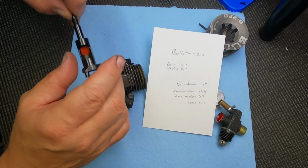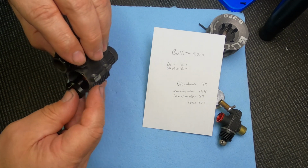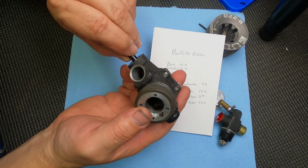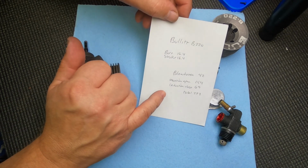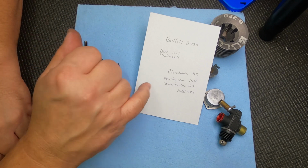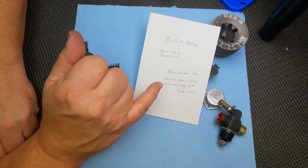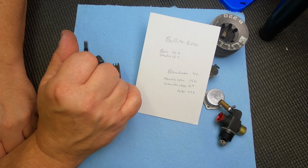That's the crank window. It's in the block. The induction opening and closing is your crank window as it opens and closes. And I think the induction closing is a little later than on some engines, maybe more like you'd have on an on-road engine. So I think that's part of the reason why it doesn't have a ton of bottom end. But it's all a trade-off.